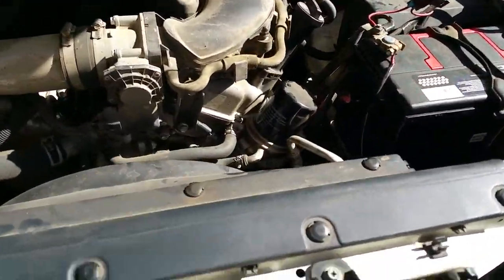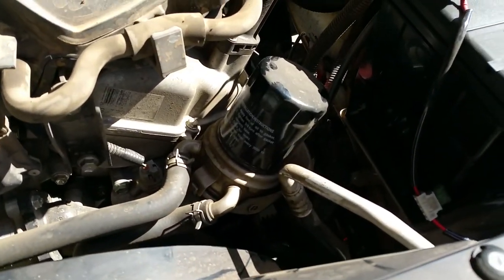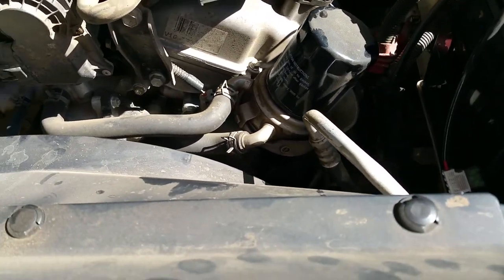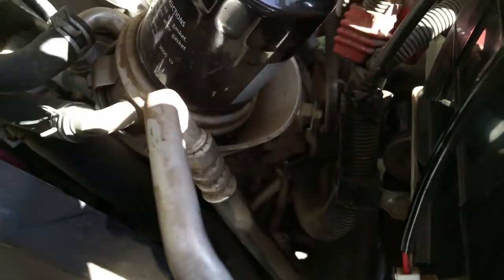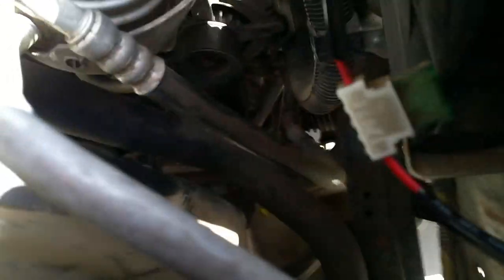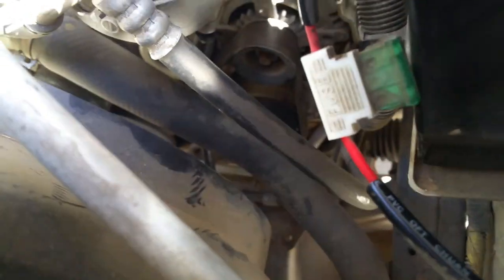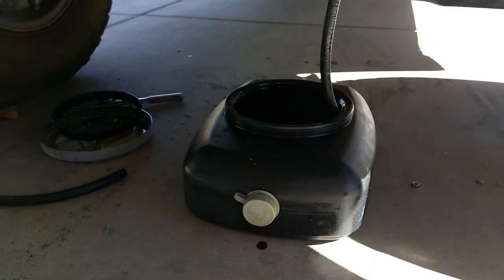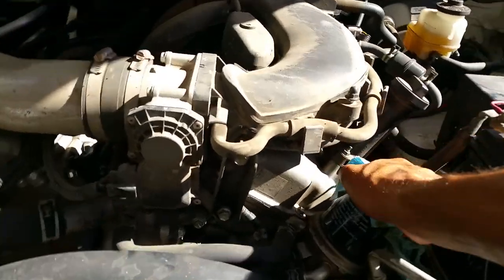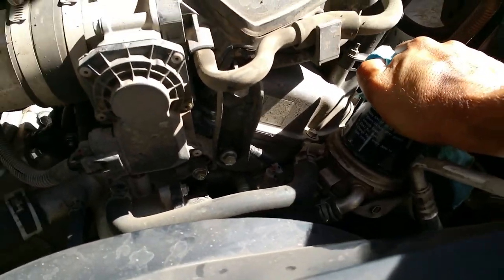So I got the oil drained out of the pan. The second thing I love about the Toyota is they put the oil filter up on top of the engine. You might think that's a stupid place — it's going to make a giant mess. But they added a little aluminum tray right around the bottom with a hole cut in it and a little stem. You go to the parts store, get three or four feet of fuel line hose, run that down to your drain pan, and the oil drains right in. It doesn't make a mess. This is even cooler than having the filter on the bottom of the engine, because bottom-mounted filters can still drain and make a mess.